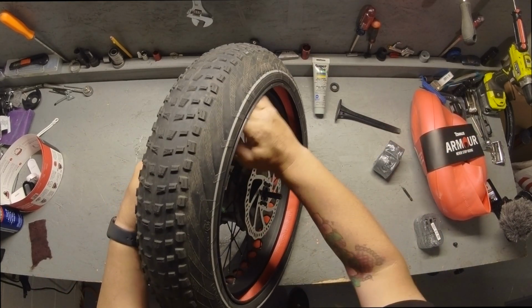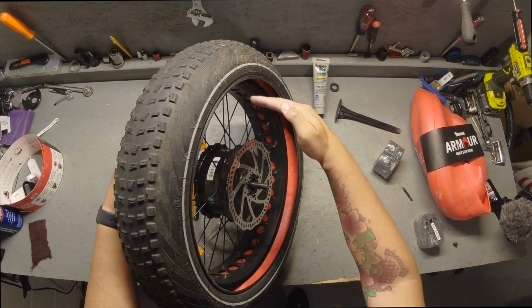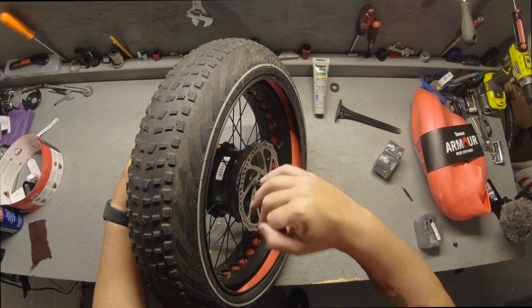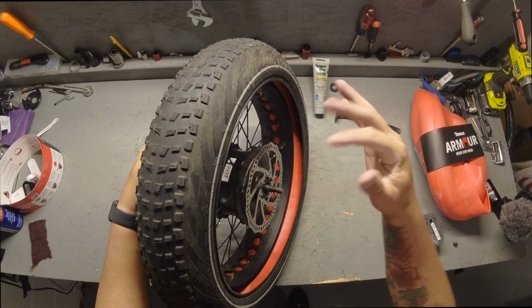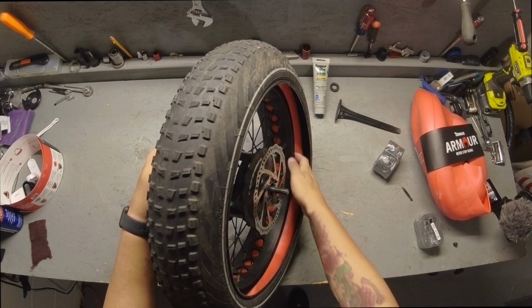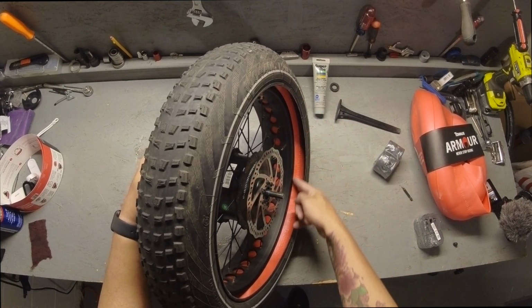So like I said, I like to run my fingers to where it tucks underneath the tube. And now the other side is already tucked underneath the tube because I rolled that in first. So the tube laid on top of the other side that's rolled under, and this one is tucked underneath the tube to where I have that protection from this inner sidewall of the rim.